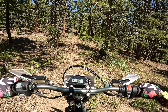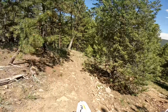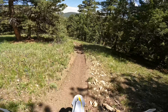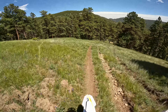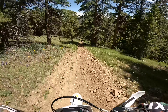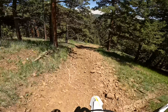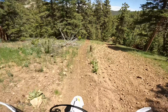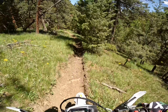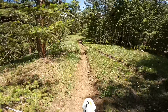Let's try the factory setting now. We're going to bump this up to B2 and see what that feels like. I can definitely feel it locking up the rear — it's not extreme, just a little bit. Gives you a little bit of extra braking in the rear. The downside is you do feel it kind of immediately lock up. So if you like to drag the rear downhill, you'll like that. If you finesse it, even B2 might be a bit stronger than you like.